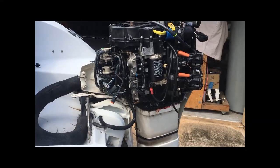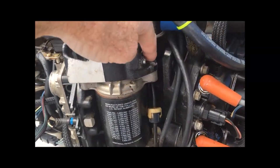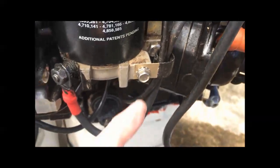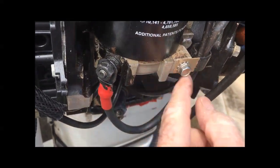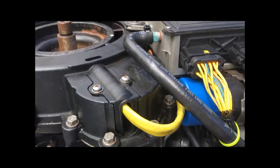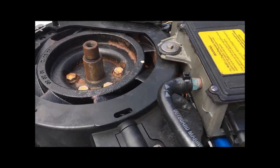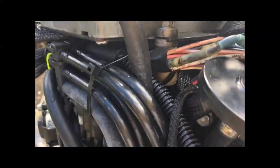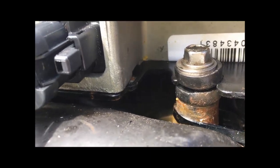All the mechanical parts are back together. Earlier in the video I pointed to the starter bolts the wrong way — they actually go this way, one here and one there, and they go down from the top. The third one is down behind that. The manual calls it a hose clamp, but it's actually a hose bracket — it holds this hose and the positive starter cable. For removing the EMM, as far as I know that's the only screw you have to undo — it's a 5/16 bolt. The 3/8 bolts on each side have a slot on the EMM.